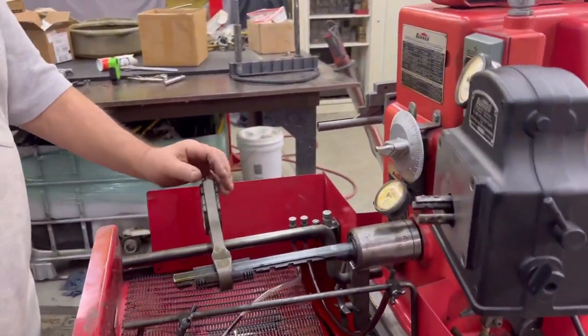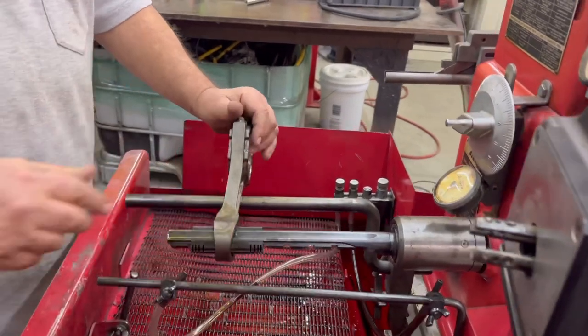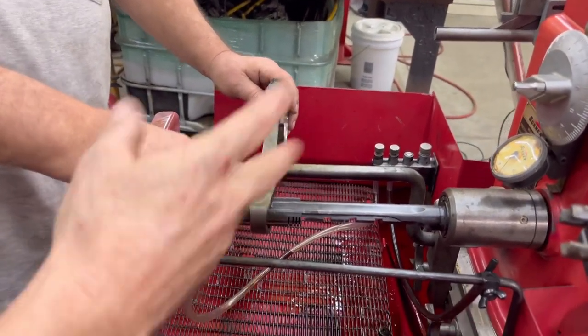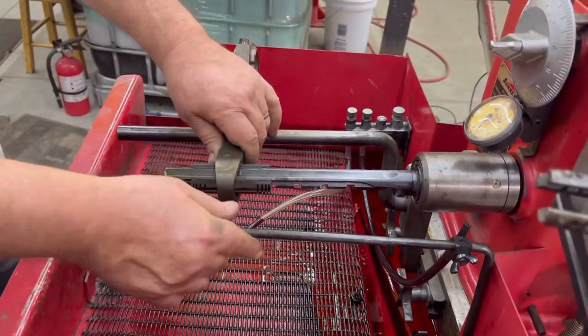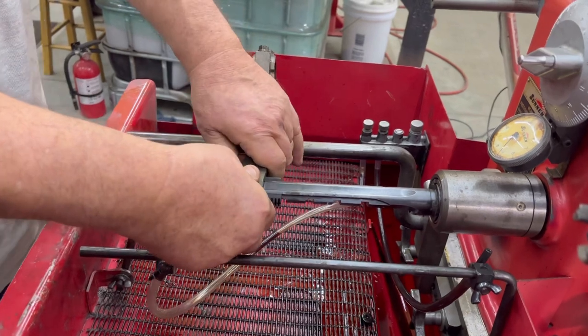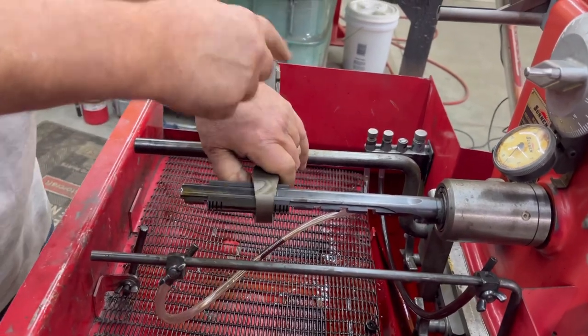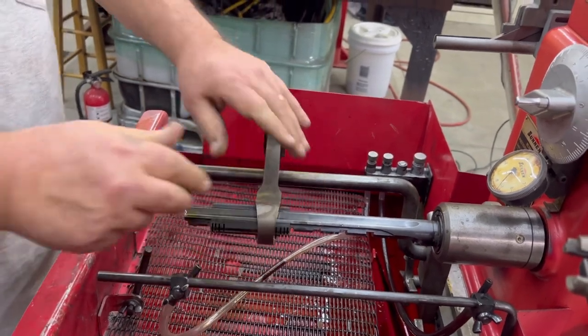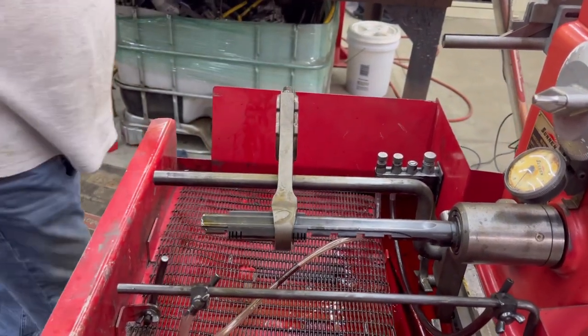Now, let me show you how to do a rod or work pieces. If I grab it out here and push and pull it, because there's going to be a little torque, what did I just effectively do? Look at what I'm doing. You're making a tapered hole. I need to be grabbing it right at the work. And your whole goal is not to let it do this. You want to stay stable and even when you're honing. That's the trick. It's operator dependent for sure.